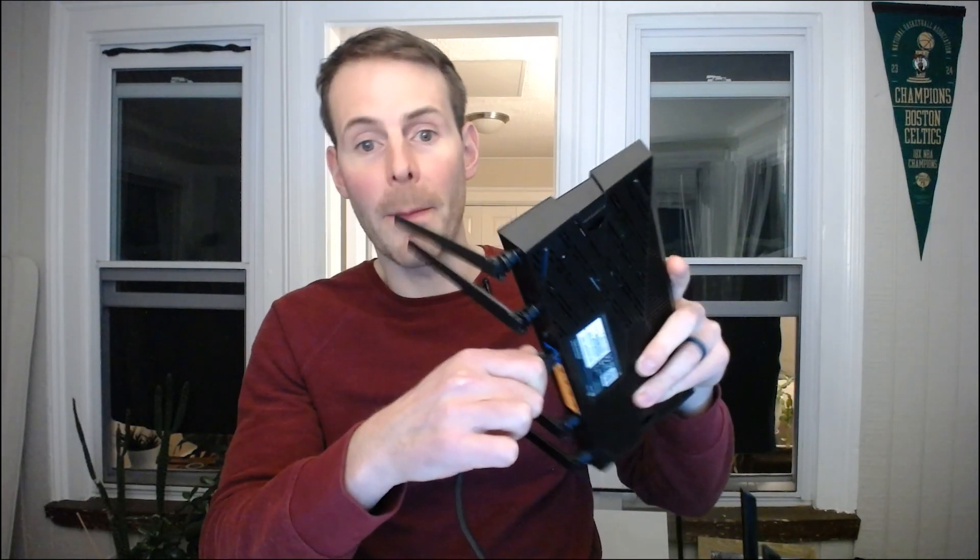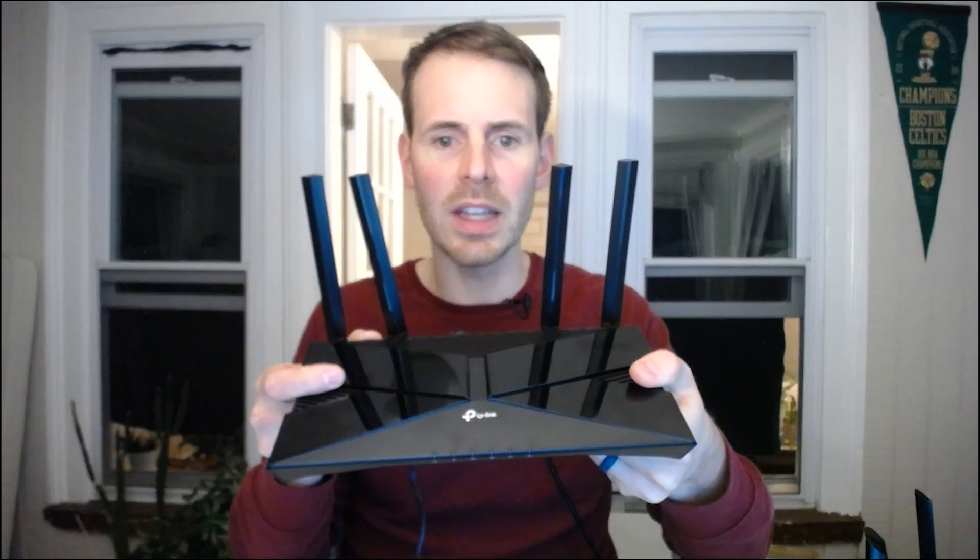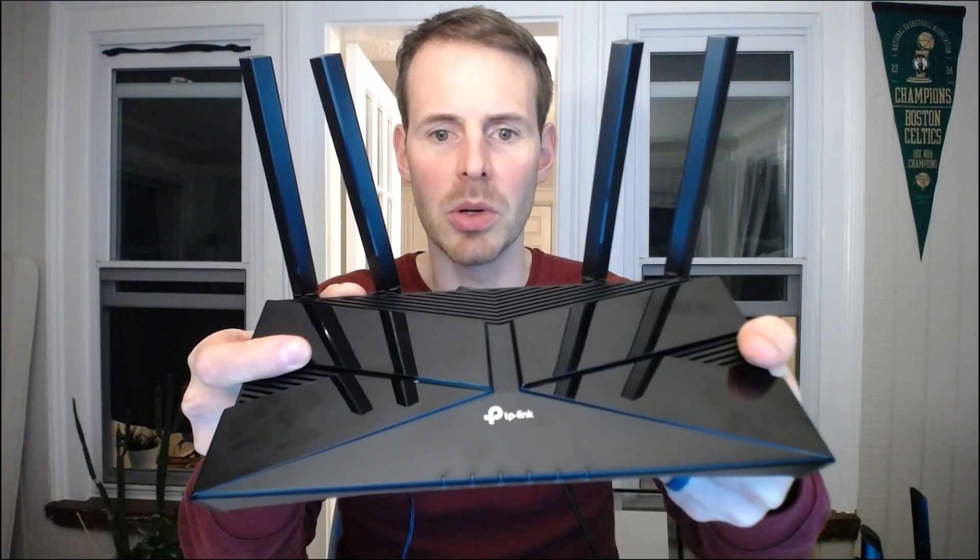Now we want to take this ethernet cable and connect it into your new router. Let's disconnect this and here's our new router — we're going to connect it to the WAN port on the back, because this router is now going to be serving as our primary router. So now we have connected to the WAN port the ethernet cable that connects our modem and router. We'll power on our modem and then power on our new router, so it will boot up and we can set up your new router as your primary router. My modem is currently rebooting, so now I'm going to power on my new router — just take the power cable, plug it into the back, and your router will start to boot as well.